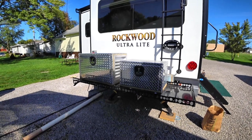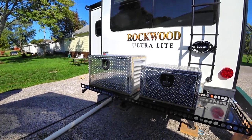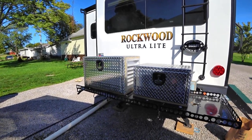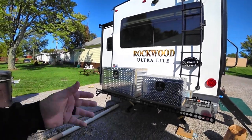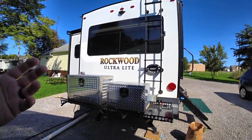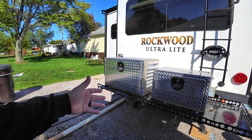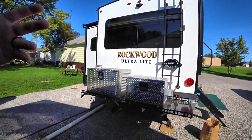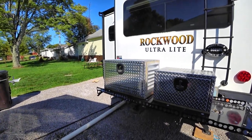This is the system for boondocking or parking lot overnight stays when you want to run your air conditioner. Power management is key: turn off the air conditioner and you can fire up the microwave — the generator handles that no problem. You can also turn on the hot water tank electric element if you don't have propane. With this generator running, I can run my rooftop 15,000 BTU air conditioner, have my computer on, and have the TV on inside — no problem whatsoever.